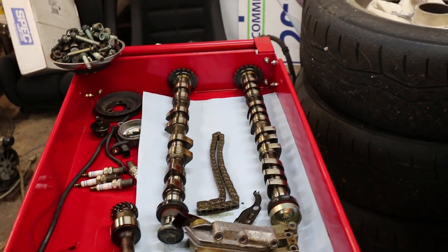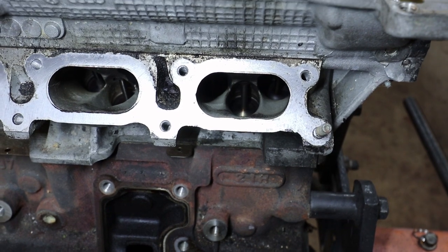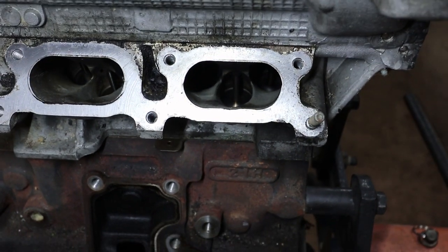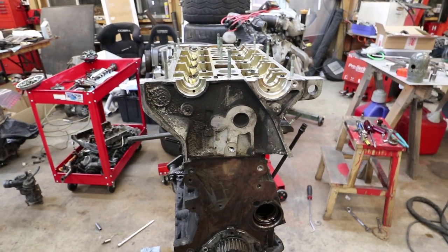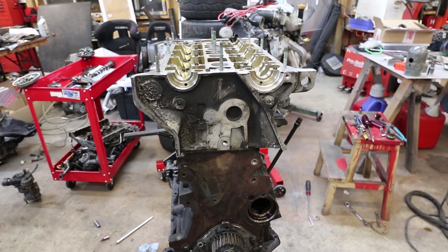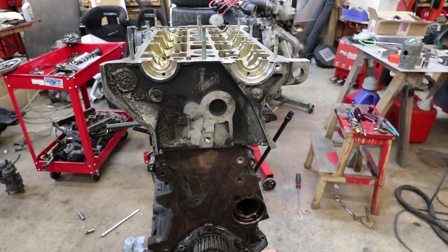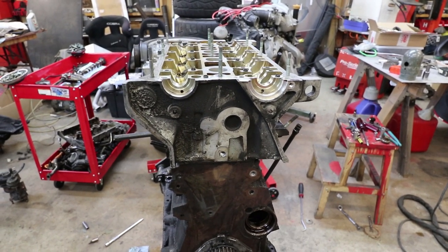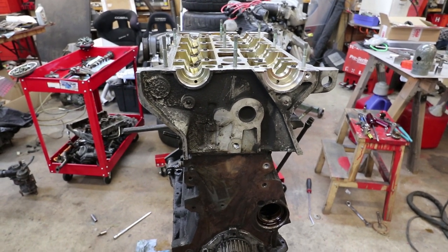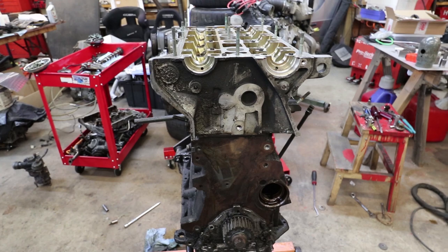As the middle valve being closest to the intake runner, maybe that's the one more likely to have a little bit of air go in during valve overlap. During valve overlap, you have an exhaust valve open at the same time as an intake valve. As the last bit of expanding exhaust gases are rushing out of the cylinder, if you open the intake valve while those gases are rushing out, it creates a little suction on the intake side and helps draw in fresh air to fill that voided space before the exhaust valve closes. Valve overlap is a technique to get a little extra air into the cylinder based on that scavenging effect.